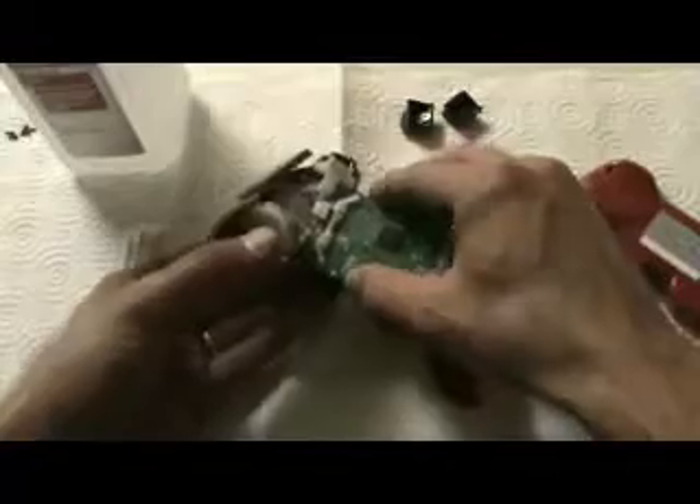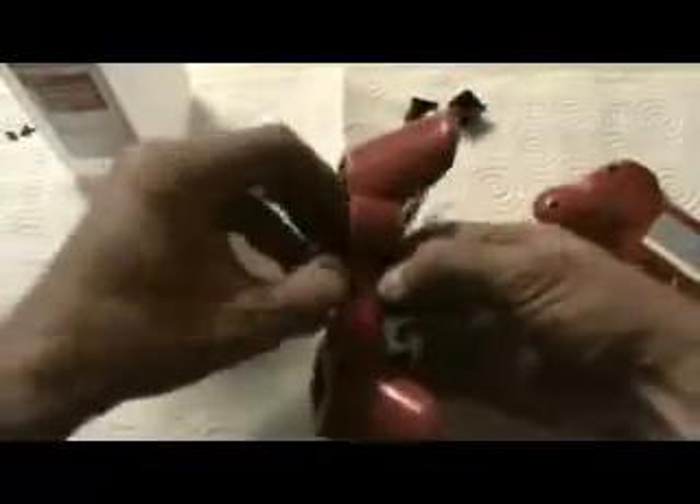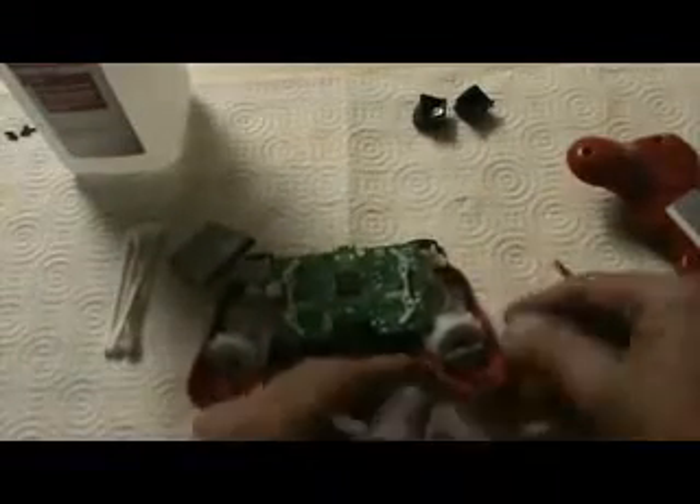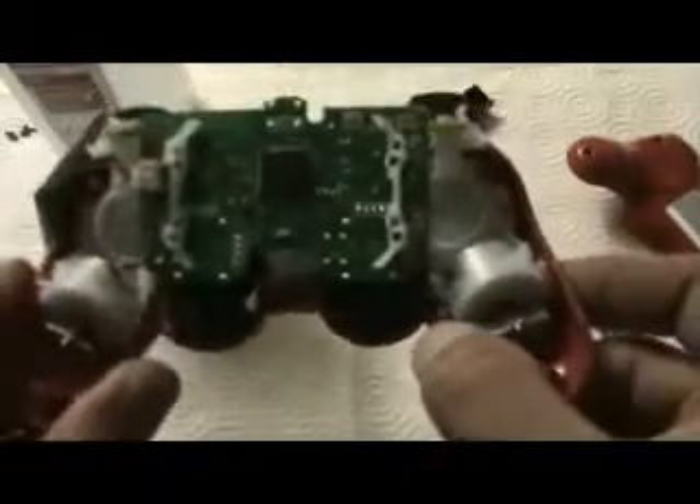Then that comes out. It's the joystick that's holding it in right now, so what you want to do is just pop the joystick there and pull it off — you can pull the tabs right off those. Now I've got it freed out. That wire is connected to the motors that make it vibrate. These have a little clip that holds them into the controller — one on each side, there's a red clip that's holding that down.